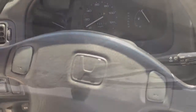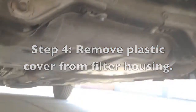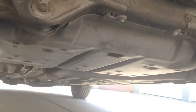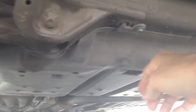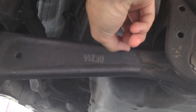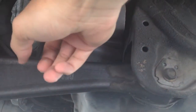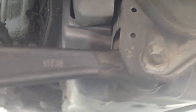Turn the car off. The next step is to take off this piece to get into the fuel filter underneath there. We're going to take off these bolts — there are some bolts you get off with a Phillips head.